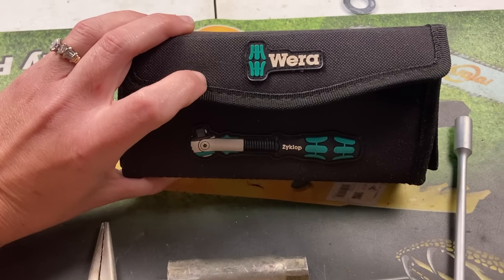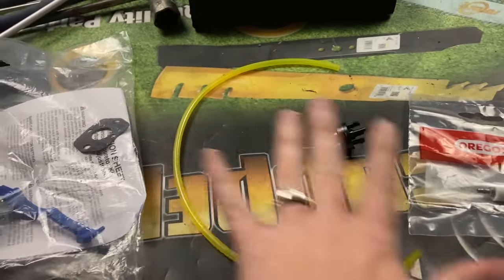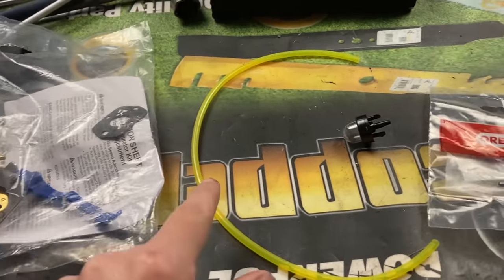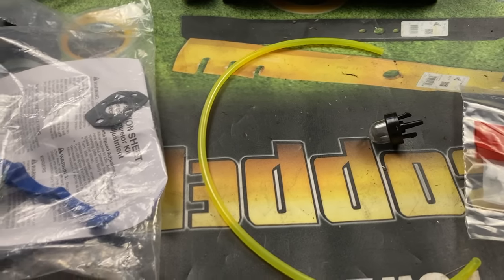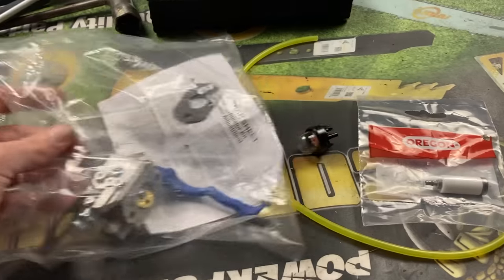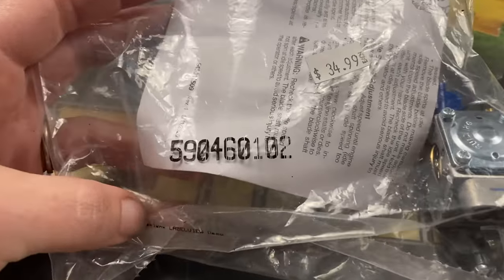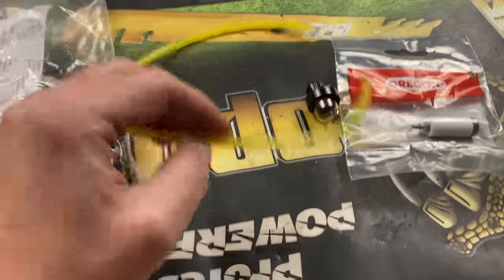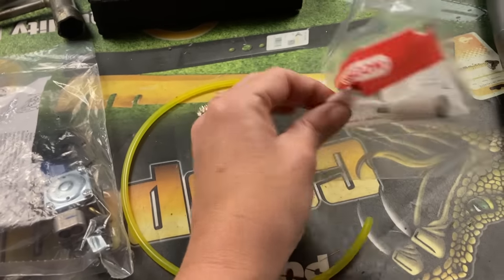Also, to take the blower apart you'll need the 4mm hex head. This is my Wera kit of sockets, Torx, and screwdrivers — it's also in the description box below. The parts you're going to want: you can get a whole kit with an OEM carburetor, fuel line, primer bulb, purge bulb, fuel filter, and tank grommet for $35 online. The part number for the carburetor is 590-460-102. The fuel line is 3/16ths outside diameter and 3/32nds inside diameter. You'll need a push-in primer bulb, a purge bulb with two nipples, and a regular fuel filter.